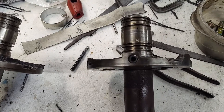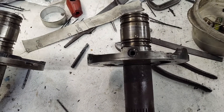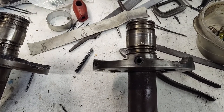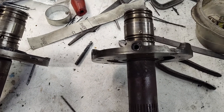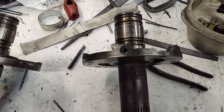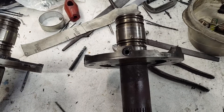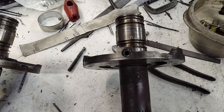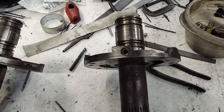If you eliminate this and the torque converter doesn't allow oil to flow through it all that well — most of them do, but I have seen some converters on the market where they don't allow oil to escape the converter like they should. A lot of converter builders don't really understand the cooler and lube circuit in the transmission, so they don't really mill the appropriate slots and things in the converter to accommodate this. And some of them are even intentionally restricting it because they want a lot of pressure in the converter — they feel like they want it to lock up and really couple well. But we create other problems when we create restriction inside the converter, so this is a very tricky balancing act.